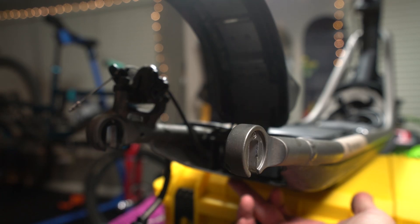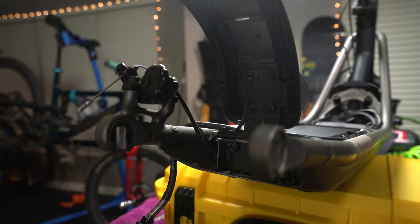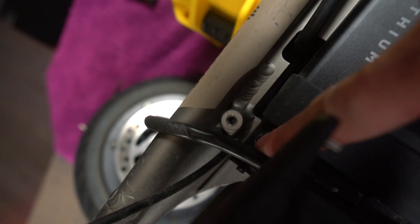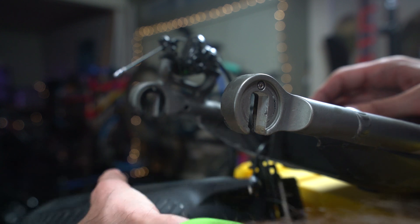I got the wheel off. We got those two screws from under there off. Now I'm going to take these guys off — I think that's going to be 3mm allen. That's one, that's two. One came out right here and then symmetrically on the other side. Just a little 3mm allen and the fender assembly comes out. There's a cable attached for the brake light, so the fender assembly is off.